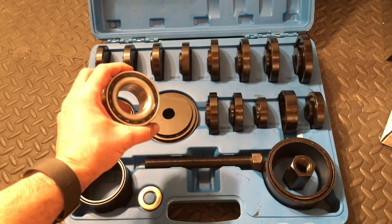Here's how it's going to look set up: we have the plate on this end that's going to be pressing the bearing out. On the other end we have the tightening nut on that bolt. On this side we have the piece where the bearing is going to be pressed into, the plate on this end, and then the tightening nut on this side — which on this particular kit is a 32 millimeter. So I'm going to be using a 32 millimeter to tighten that. We're going to hold one end solid, tighten up this tightening nut, and that'll start pulling it in and pressing it out.